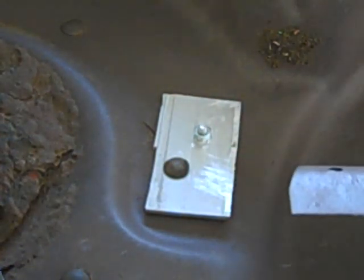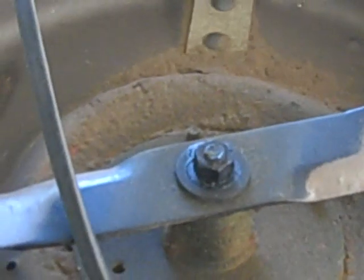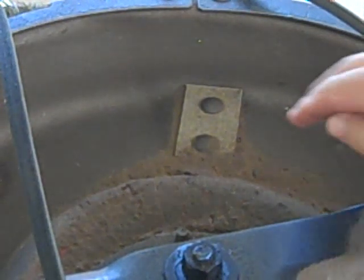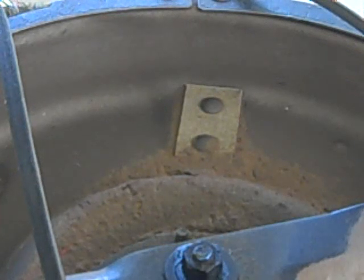Now, how do I know that this method works? Well, I've used it over here on another part of the lawnmower previously. In this case, I actually had two carriage bolts to work with. And the reason I put in two there was, of course, otherwise that backing plate would tend to work back and forth, and you don't want that to happen. You want it to be stable once you put it in there. So hence two bolts at least to hold it.